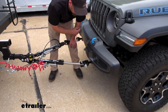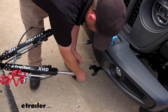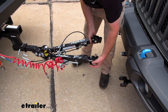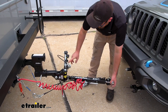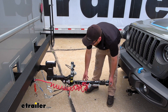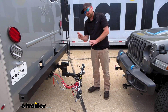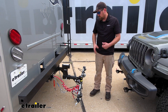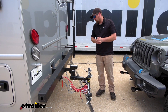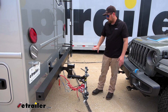Something pretty neat about this tow bar is you can actually keep it stored on the back of your motorhome. Once you have it all disconnected, you get the pin in, fold the arms like that and they drop right into place. I like this — it has an advantage as far as storing goes over some of the other ones. Having independent arms makes it really easy to swing these in and lock them down. Some other tow bars require you to lift the whole unit, get it into a small notch and tilt it, so this is a little more user-friendly.